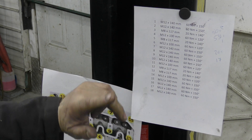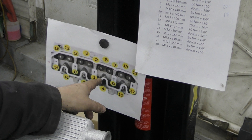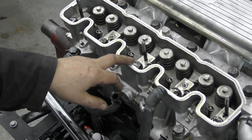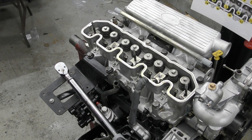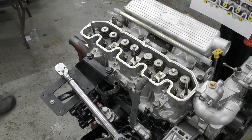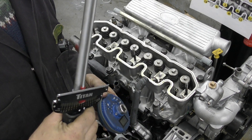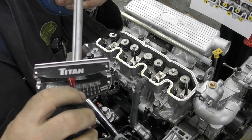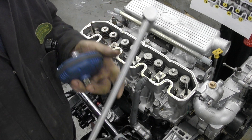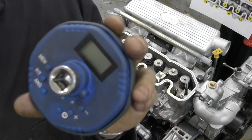I've got them all down there so I can read off top to bottom. This should be on the memory stick — if it isn't, let me know and I'll send you a copy. I've also got a picture of the head bolts, which also should be on the memory stick, corresponding to the cylinder head down here. The tool I used to use was actually two tools: this little simple device for setting the bolts to either 20 Newton meters or 60 Newton meters — I put a little dot of paint on it — and I used to use a laser tool.